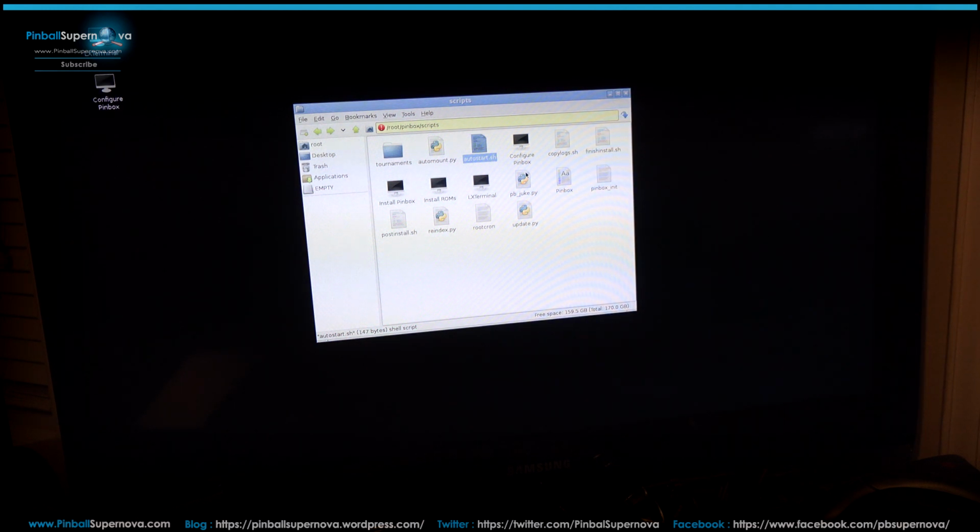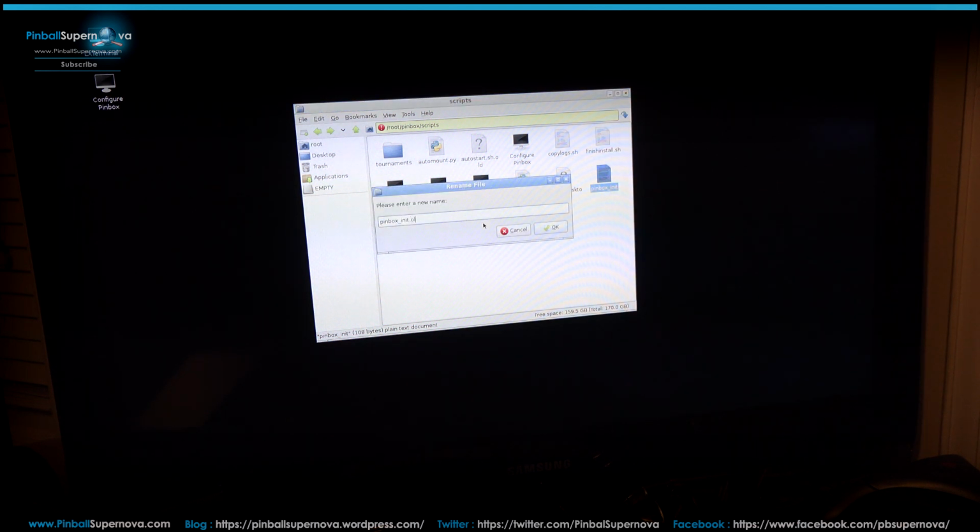And how I stop doing that, or if I ever want to boot this, I'll boot into it, hit the F1 key, get back into this screen, and then at the end here I'll take these 3 files and go to rename, and at the end of it I just type .old. So now that's called .old. Call this one .old, and you can see that the icon changes to a question mark. And then you got that one, and this init maybe. I'm kind of guessing it's one of these 3 that cause your thing to restart, to boot into that menu. Hit .old.